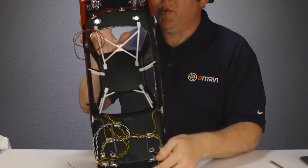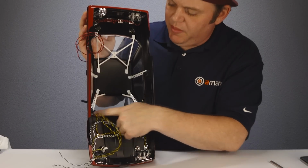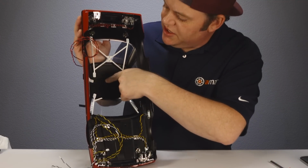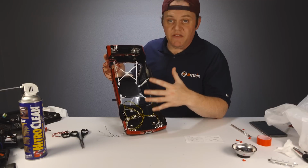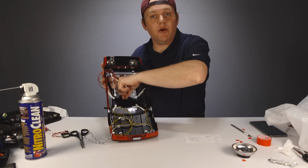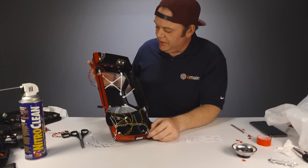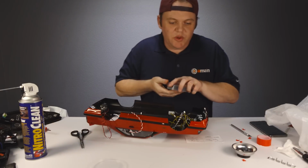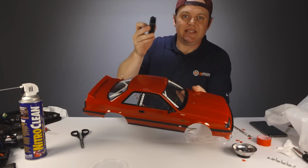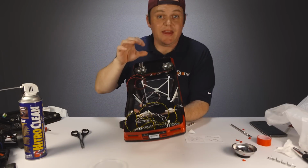So there is plenty of room up in the top here, and I think I'll run our wires, maybe the front wires in this channel, put our controller up here, run the rear wires in this channel. It should be somewhat invisible and out of sight. The only wire that will be exposed will be the wire going from the controller to the receiver. It's gonna dangle from the roof, just not really ideal. So to keep the wires looking really stealth in these window columns, I'm gonna try to use some of this really sticky 3M electrical tape to get it flat and to keep it black.